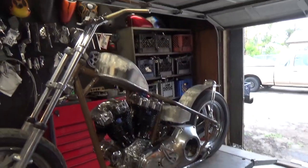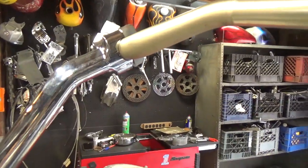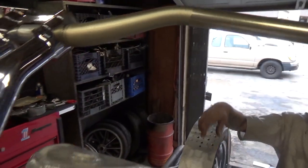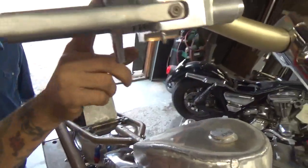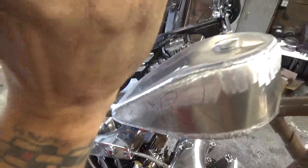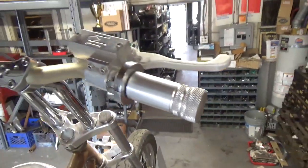The bars are cool — those are, another thing from my childhood, mid-nineties motocross bars made by Pro Taper. They're inch and one eighth in the center and they taper down to seven eighths. It's a PM lever, but I shortened the lever and then it's like a 1950s era chopper throttle — quarter turn, shortened way down. The grip is a Drag Specialties aluminum. The thing should be pretty nineties meets mini, kind of choppered up.